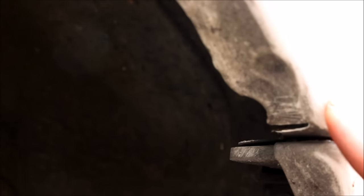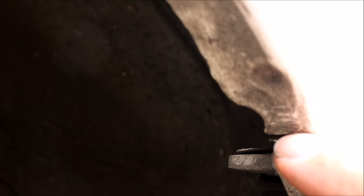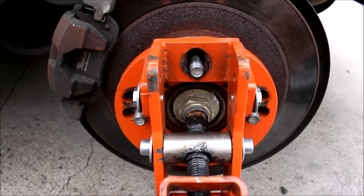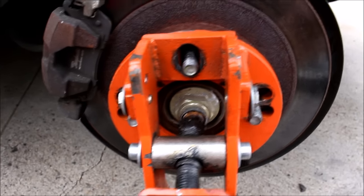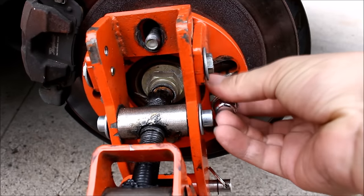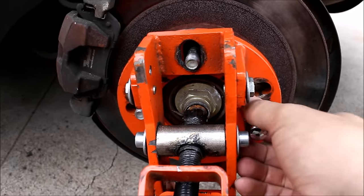You don't want to be able to see the cut from the outside of the car. You want to go pretty much as deep as you can, because if you try to roll this last bit of the fender it won't want to roll up, and that's one of the major clearance issues trying to fit aggressive offset wheels. Even though I'm not ready to roll yet, I'm going to go ahead and get the roller ready — it goes on just like a wheel and then you throw a couple lug nuts on it, just snug against the hub.